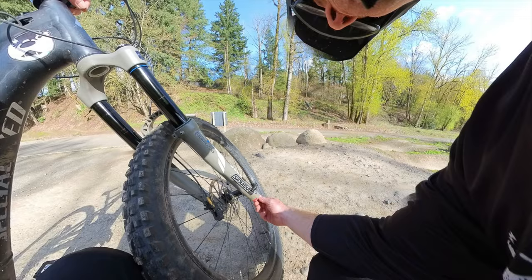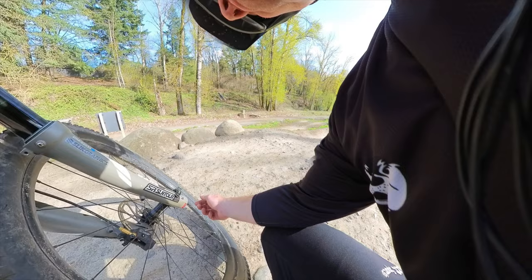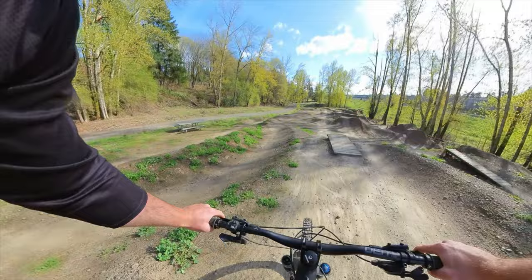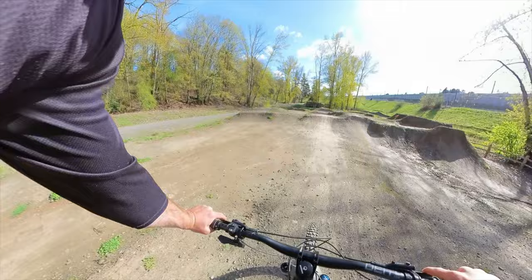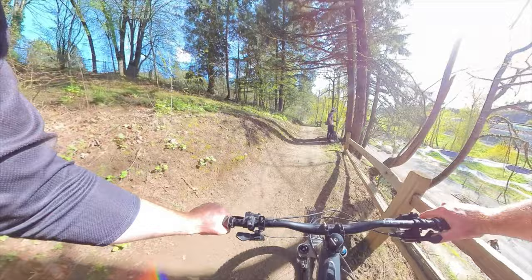There are certain forks like the RockShox Yari where you have to run a super fast rebound to make it not feel harsh. What I recommend if you have a Suntour suspension fork: take the rebound to the full fast setting — full minus — then run it on some jump trails and feel how it feels. Then go to the full plus setting which is full slow and rerun that same section of trail to feel the difference. The rebound damping on Suntour is very special, let's say, and speeding the rebound up did not fix the issue.